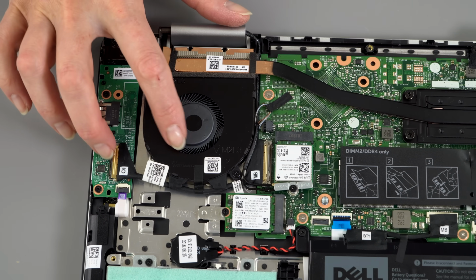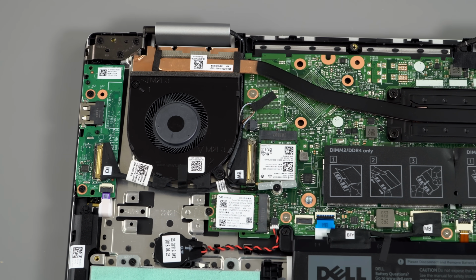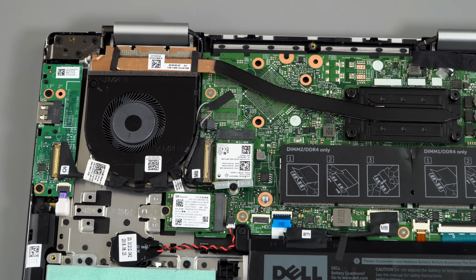Again, that's pretty normal for Ultrabooks, but it's not one of the premium ones that actually goes beyond and manages to go higher. The core temperatures on this one running something like a PCMark 10 benchmark will hit into the 90s centigrade, 100 is allowable. This is pretty much standard for today's Ultrabooks. It doesn't get that hot to the touch though, in part because it's quite thick. It has a decent sized fan. It does not get loud either. The fan noise is not annoying. There is a little bit of coil whine on ours.